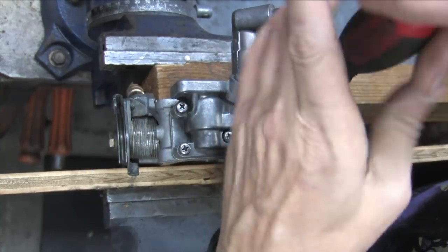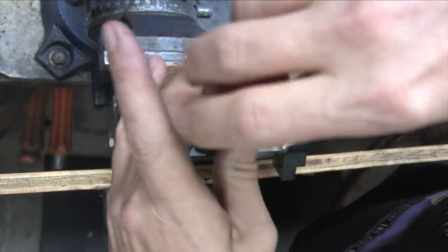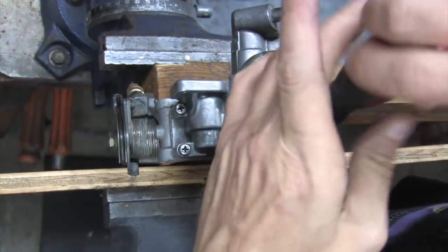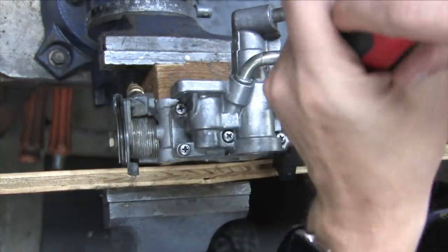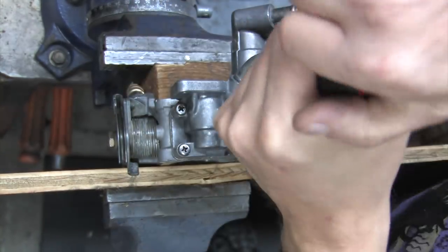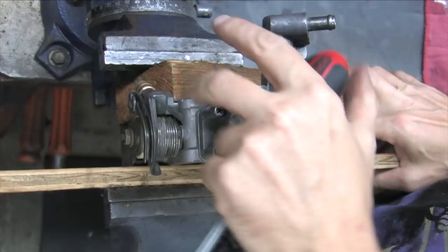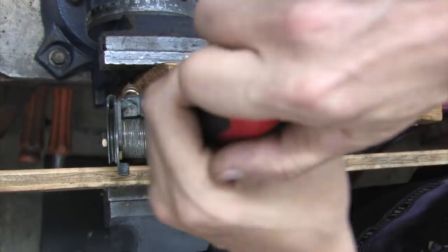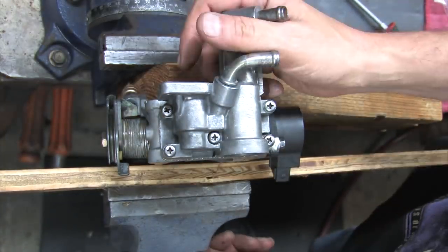I told you when this thing started that I was more interested in making these throttle bodies work properly than I was with installing and removing them. A blocked-off fast idle air valve and/or no idle speed control motor is not going to make your street car run properly. In addition, I would also have needed longer bolts, probably cap screws, to install it because of the thickness of the plate. I put all of it back together the way it's supposed to be.